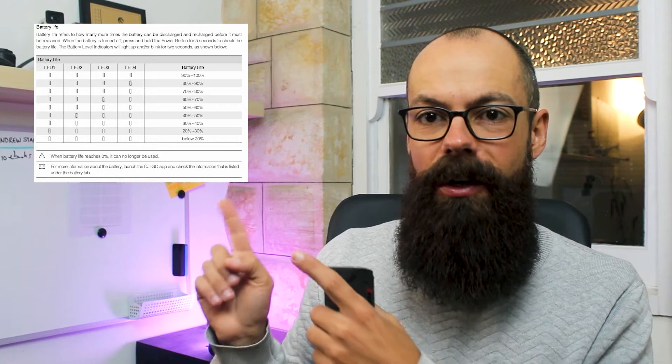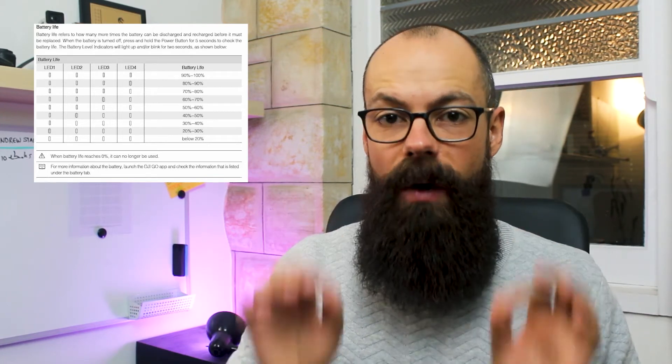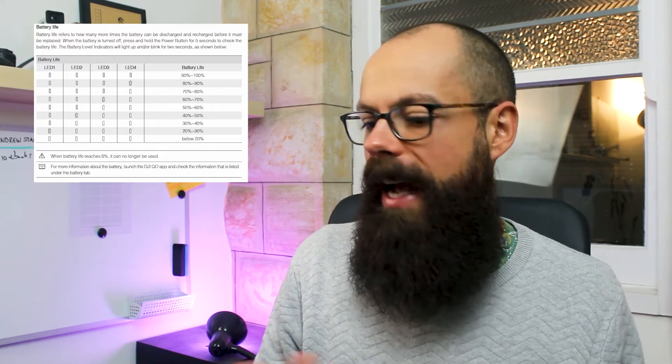What I recommend you do is check your manual specific to that model of drone and its smart battery, because it's going to vary slightly. As DJI changes its software in the smart battery and its hardware interfacing, you'll come across different nuances in the ways you can tell if the battery is in good health. Go check it out in your manual — it will tell you how long to push the button and what the lights mean when they start flashing. Here there are four lights, and you want to make sure you understand what they're telling you. I'll put a little diagram here of what you're looking for, but that is a way to test some DJI batteries — it tends to be the older models.